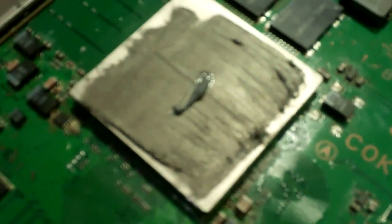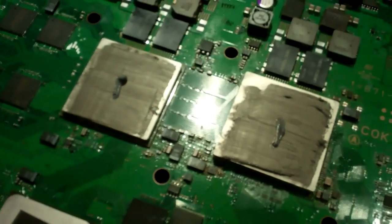What we found underneath this heat spreader is that these units had a lot of resin-based flux on them from a previous repair, which we didn't really notice until we took it apart this last time. I used some deionized water to clean up a lot of that resin-based flux around the chip, then pulled the heat spreader and reapplied it with Arctic Silver 5 after scraping it and cleaning it. We have them back together and ready to go, and we're going to reassemble and see how it is.